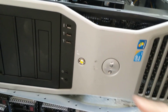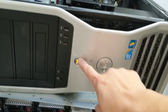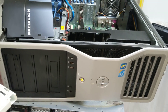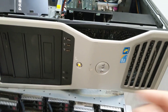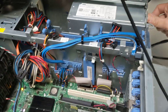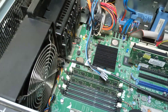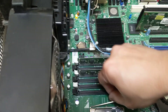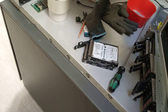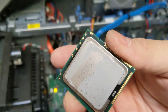As you can see, there's error codes two, three, four and the amber lights. This indicates the CPU is not supported or the CPU is faulty. But I know the CPU is working because it was taken from another Dell T3500.